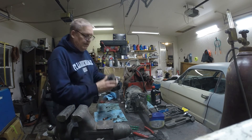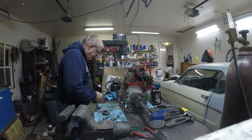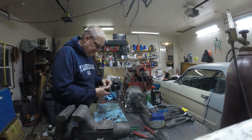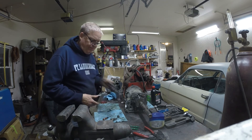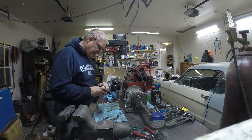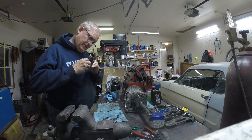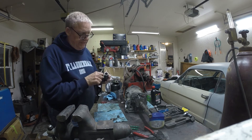We've got this all cleaned out and blown out nice and clean, going back together. We'll lube it up with some transmission fluid — we don't want that stuff sticking. Put that in there, make sure it goes all the way to the bottom, rattle it around to make sure everything moves like it should. Nice and free rattling. Put that spring in there, then slide that up-plate back in there, work with that spring a little as we go in, and now we've got her locked into place.